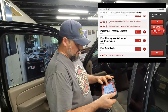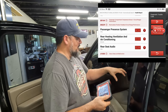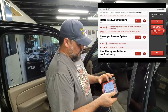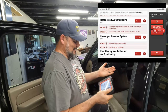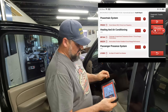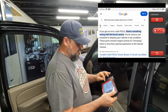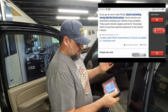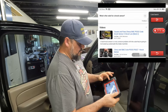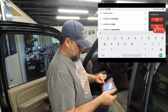There's also a rear seat audio data link malfunction — I have the headliner out and the interior disconnected, seats removed for headliner work, so a lot of stuff has been disconnected and that's why it's throwing codes. Passenger presence system: yeah, there's no passenger seat so it's not working. Anyway, you can see all your codes just like any other scanner. It's a nice quick interface, and you can click a question mark to pull up a browser that Googles that code for you so you can troubleshoot.